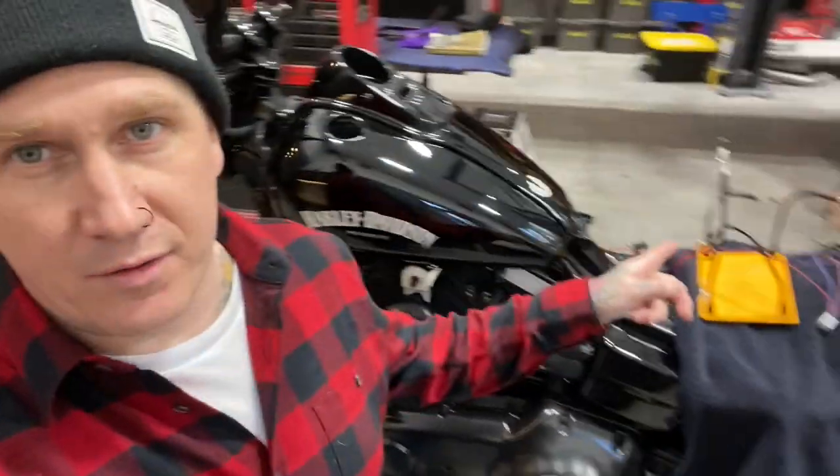Back in the garage. Me and Jai worked pretty late last night. I've got everything set up — I'm going to wire this load equalizer on the rear tail light section, get that done, then mount the front signals and get those wired, and then hopefully put the battery box in and get the lights working.